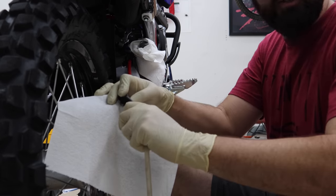Since I'm happy with it like this, I'm going to get my banjo bolt with the crush washer and bolt this up. When they have a little bit of a twist like that, getting these to thread can be a little bit of a pain — you may want to take the rest of the brake line and kind of wrench it over while you tighten it so you can get it to start. I am trying to do this where the banjo rests up against the factory little bump stop, which should keep the line from ever trying to twist or loosen up on us. Remember, this line is going to be moving around, so it's good if you can use those bump stops. I'm also going to get my brake bracket back on — this is the one designed to hold the ABS sensor as well, but I have ordered the correct one.